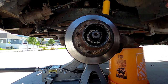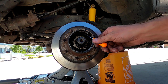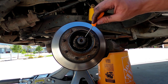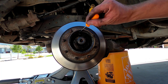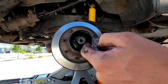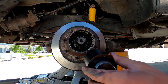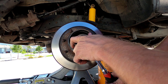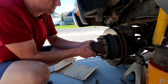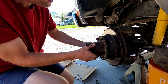There's one nut off. Now there is another identical nut back in there, but first there's a little washer — get a pick or screwdriver to pull it out. You can see this also has a little key on it to line up with the threads. And now we just need to loosen that last nut. It's ready to come off — when you pull it off, don't let it sag down onto the axle; you don't want to scratch that. Grab it with two hands.